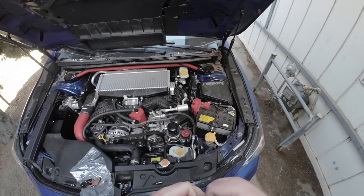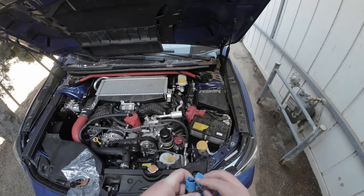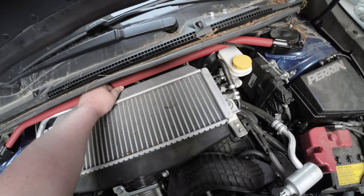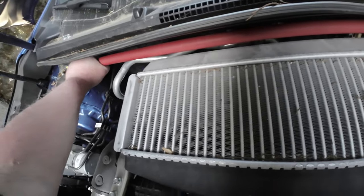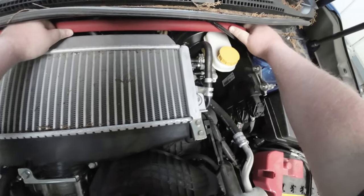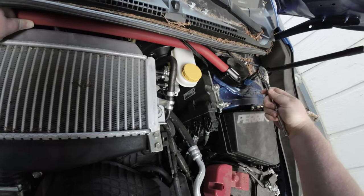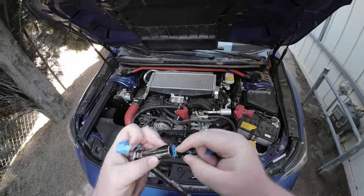The feet weren't scuffed so I really don't care — I'm not under there staring at the part all day. From this point, push the strut bar itself back towards the cab of the car, then snug down each nut. Don't over-tighten them because you're going to torque them down after this. They say it is 22 foot-pounds of torque. I just have a cheapo click-type torque wrench. You don't have to torque them down, but I tried to stick to the instructions as much as possible. Same goes for the little screws on the feet cap. This is where I noticed the tape failed me.